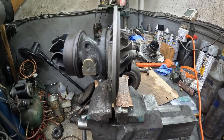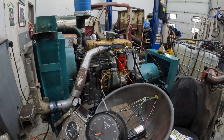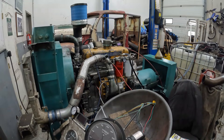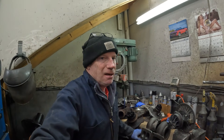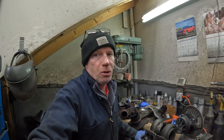You'll see references to that all the time. What I'm trying to do now, because I'm outside the parameters of this engine — I'm moving a lot more air through it — I've got to find a turbo and match it to those injectors. Without throwing a lot of money at this, I basically have enough in my stock that I can experiment and get a very good idea of what turbo works and what doesn't. Buying turbos through eBay, if you don't buy OEM products, it's frustrating — you'll order a turbo that's 61-65 and end up with a 69-63. I've got enough on my shelves, I can build a turbo and test.